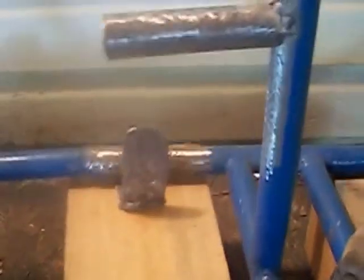An upper and lower mount, engine mount, the rear mounts. Just doing a fab of mock-up with the measurements for where the motor mount's got to go, and the lower ones. Just welded up some angled plate. And this black mark here is where the lower engine mount's got to go.